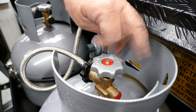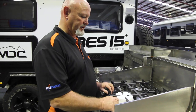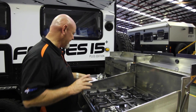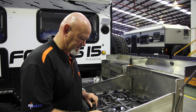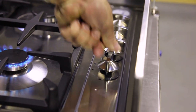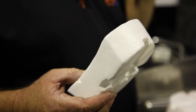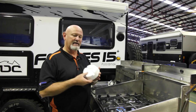Come to your burner. You have to take all the polystyrene locks off because they're for protection, but you must take them off before you light your stove. Push down, hold for five seconds, then your burner's on. Wait for at least half an hour before you put these back in place if you're going to be traveling, because the cast-iron plates will melt them.